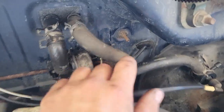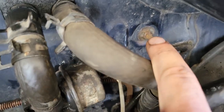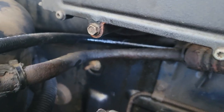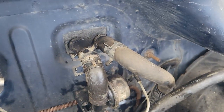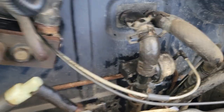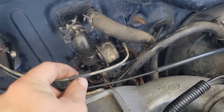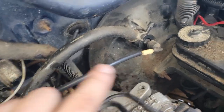And to put the box back in, this is an 11 millimeter sheet metal nut. Got one there, got one there, got one directly below it, and we got one back there. Then I got the heater core lines back in. I still gotta put the clamps on, it looks like, but they're on. And then I got the vacuum lines coming out, and this gray one, which I've spliced here, goes into that valve. And then this one, which I've spliced, goes into the brake booster.